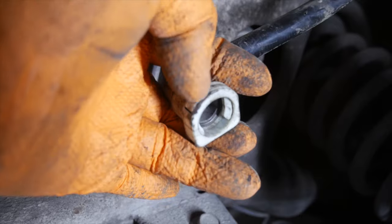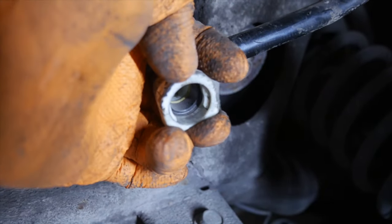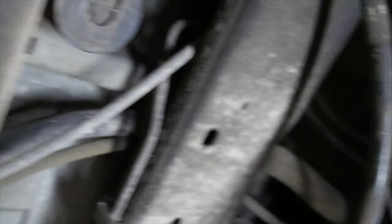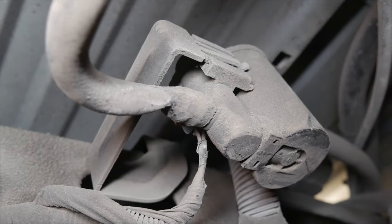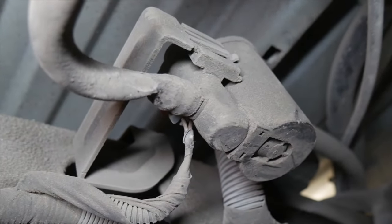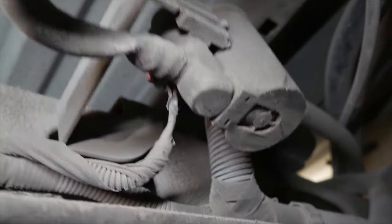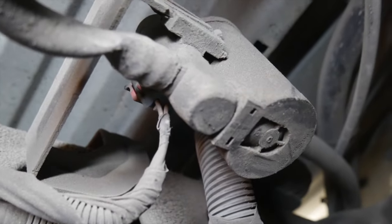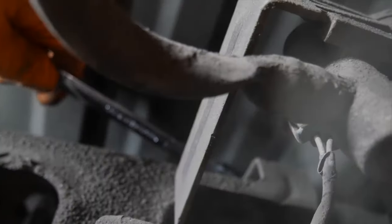So basically you can take a screwdriver. I took my fingertip and just pushed it on that clip, and then I was able to pull that off, and then you can pull it out from under this cross member here, and it's ready to come off now. So on that canister, that bracket right there goes over the top. It's kind of an S there, and then it's basically a 13 millimeter wrench to get that off. Ratchet wrench works really well. Take that off and that canister will drop down.